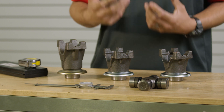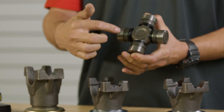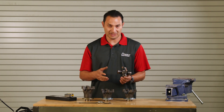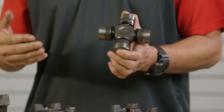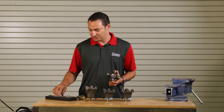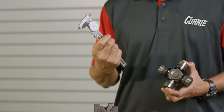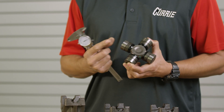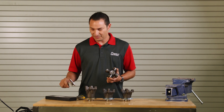Important pieces of information: when you're measuring a U-joint, what you want to do is measure the width of the U-joint and the diameter of the cap. Those two things are going to determine which yoke you need to fit your application — of course, if you're trying to keep the drive shaft that's in your car. The tools you're going to need are really basic, just a tape measure. And if you do have it, a set of calipers would be really good so you can get it accurate. The diameter of the U-joints only vary by a sixteenth of an inch, so it's a lot easier if you've got a set of these. You can pick them up from Harbor Freight fairly easily.